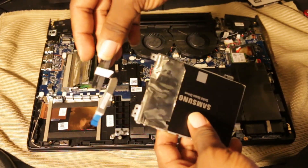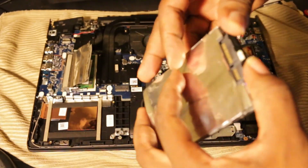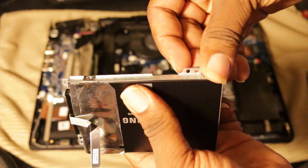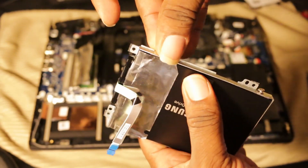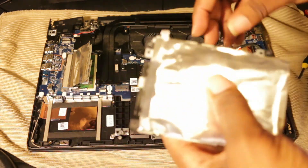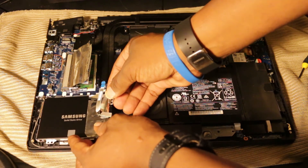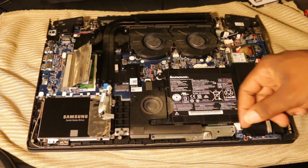Put the connector back on — this provides your SATA and power through this connector piece. Put that back on firmly, then put your four screws back in around the housing. Once all four screws are back in, put the bracket housing back in and make sure you turn it in the correct direction so that the blue connector can go back into its connection slot.